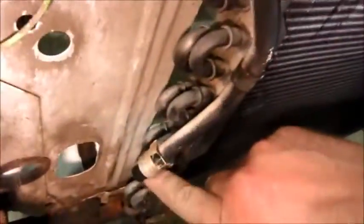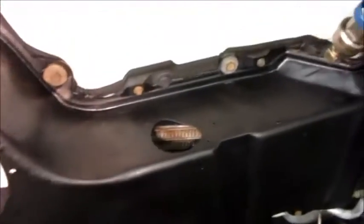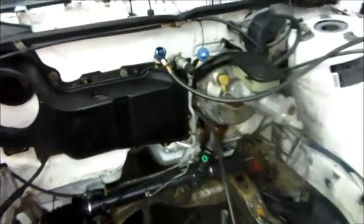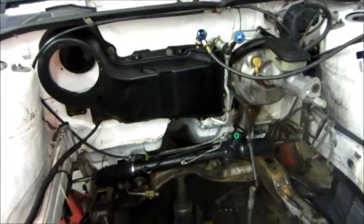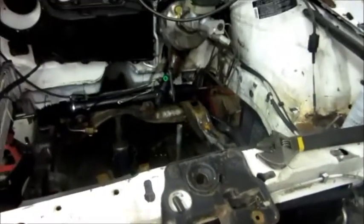One last thing for the day. I've got the vacuum pump on the partial air conditioning system. I've got a cap on that, and at the condenser I've got a rubber plug in there so I can make sure there's no water that stays trapped in the condenser and corrodes it, just like the evaporator. I've got the evaporator case put back on with some new sealant — all clean in there. I'm getting a new home for that blower. Getting all the cleaned up and refurbished parts put back on. Once I get all that done, I'll be able to focus back on the engine. I did get the support for the auxiliary fan — got that mounted and need to make sure the tubing lines up with the new hole. That's another day's project.